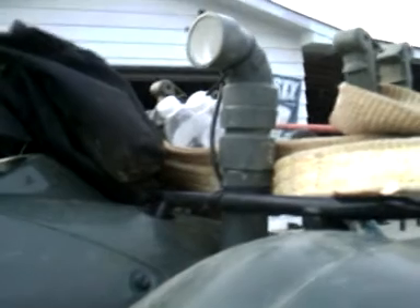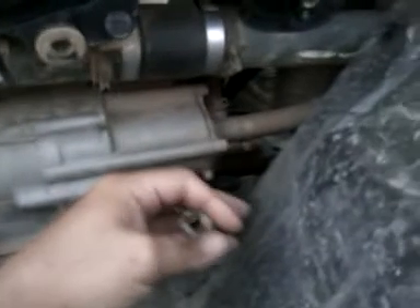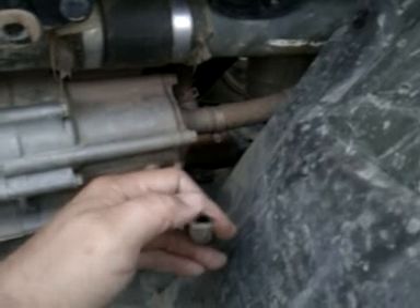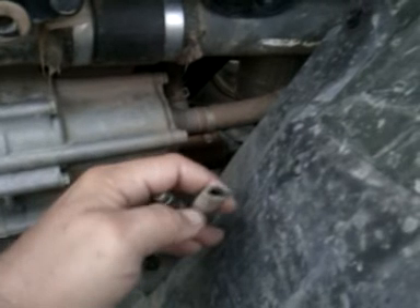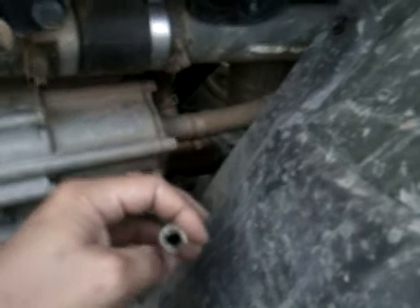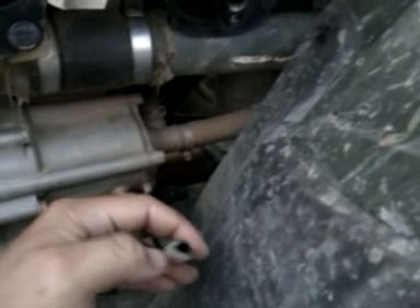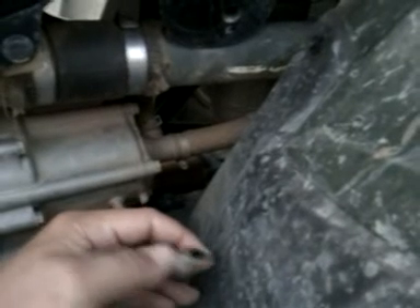I built this one and one for my cousin's 420 4x4. When you're riding in deep water — and we only do it temporarily, not to plug it all the time — you've got to plug the crankcase tube with a bolt. I read on one of the forums that plugging this hole means you won't get any water in your oil. We just take a bolt, stick it in there, and put a zip tie or a pipe clamp around the hose to keep it in.